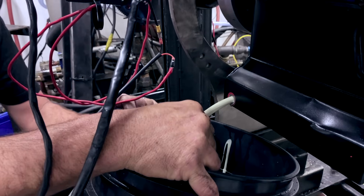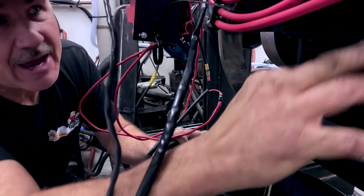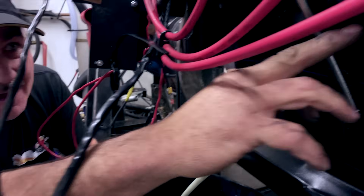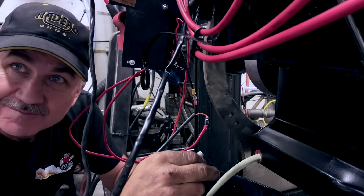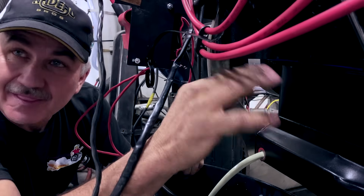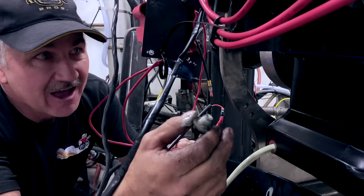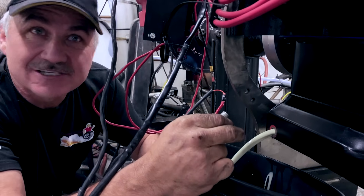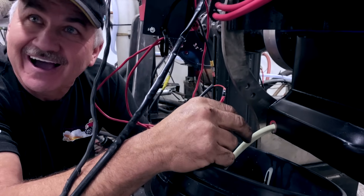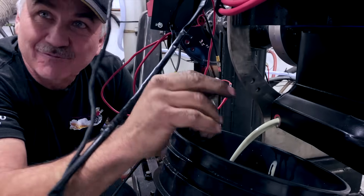That's all the alcohol mixing with the oil, which is normal — that's why I use block heaters. I plug in my car two hours before, and it separates the oil from the alcohol. I do a run, takes me about five seconds, mid-five seconds, and I plug it back in as soon as I've done my run. My oil always stays perfectly clear.